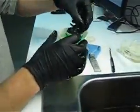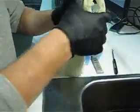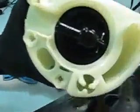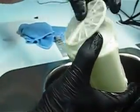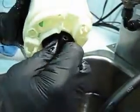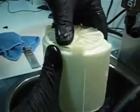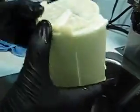So the O-ring then goes on top. This O-ring doesn't really seal anything. All it does is kind of act as a spacer. Go ahead, clip it in place. You should be properly aligned there, right here. And then what this does is it allows you to locate this hole properly in the pump, which should line up with this little groove right here. And if it doesn't, you can grab right here and kind of twist the pump a little bit. But make sure you push it down into that hole and then fully seat the filter.